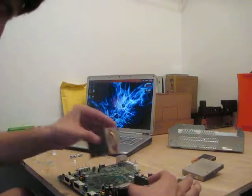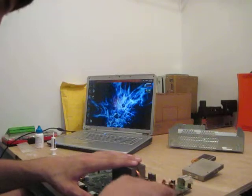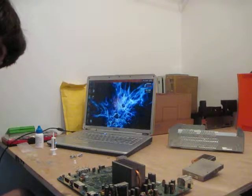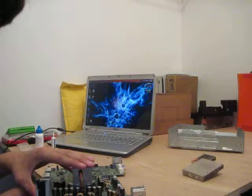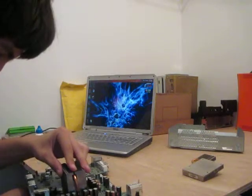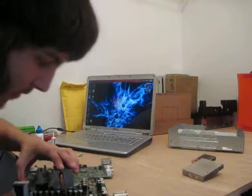hold the motherboard down, set your heat sink on top, then what you're going to want to do is slide it onto the table of some sort, and grab the screw before it falls out, kind of just tighten it in there, then slide the next one off, just kind of tighten it in there. You're going to work your way to each one.